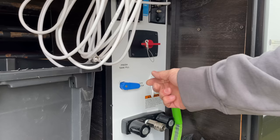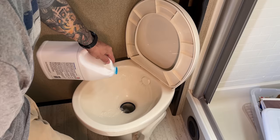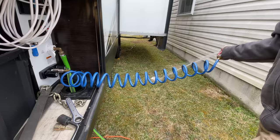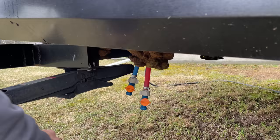I need 7 ounces of bleach, so I'm going to dilute that into about 3.5 gallons of water and then pour that into the freshwater tank. Next, fill up the freshwater tank to capacity to complete the sanitizing solution. Turn on your water pump and run water through every faucet and spray port until you smell bleach coming through that faucet. Make sure as you're running the sanitizing solution through each faucet, you do the hot side, close the hot side, and then do the cold side — they have to be done separately. We're going to be adding black tank treatment to our black tank and those treatments have enzymes and chemicals that break down human waste. Bleach is known to kill those enzymes, so we don't want to run our sanitizing solution through the toilet into the black tank. After you've done all your faucets, go ahead and crack open for just a second your low point drains to get the antifreeze out of there and the solution in. You can go ahead and turn your water pump off, and now we want to let that sanitizing solution sit in the freshwater tank and the plumbing lines for four to eight hours.